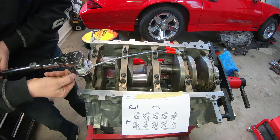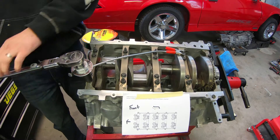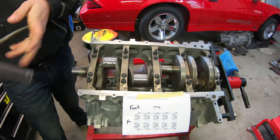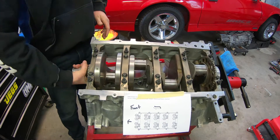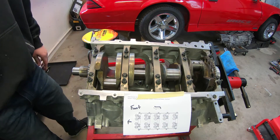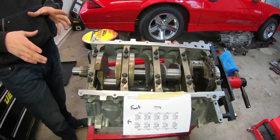Next video is going to be putting the pistons in, checking the rod and cap bearing clearances — I'll show you how to do that — and then putting them all into their home and buttoning up the bottom end and the rotating assembly. Just like that, all the bottom end caps are torqued properly. I'm going to spin it over — everything's still spinning freely, no change — and that's exactly what you want. If it gets harder to spin or you feel something that's not right, go back and check your steps. Thanks for watching, hit the subscribe button, leave a thumbs up, and share if this was helpful.